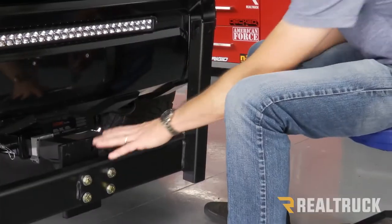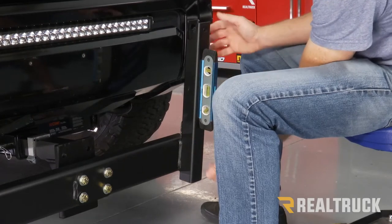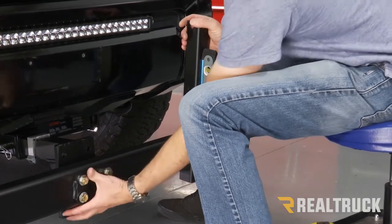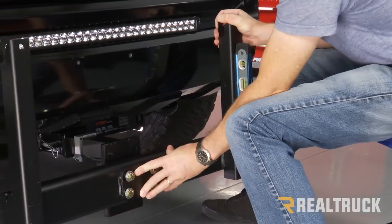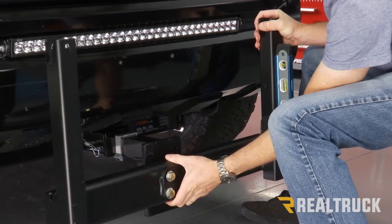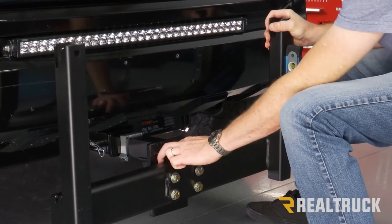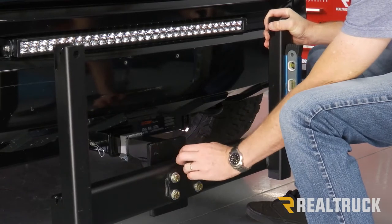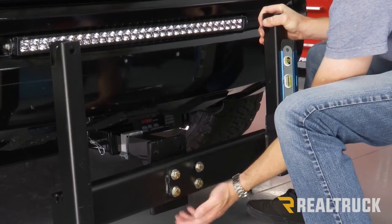Next, we need to make sure that this is going to be plumb. So what we're gonna do is attach a level to the upright on the push frame and push it up against the interceptor. Now we're gonna take a look and that bubble is further away. So this needs to come out this way. So we're gonna need to attach some shims to the front. Now, if this was actually leaned towards the truck, we would need to put the shims on the bottom